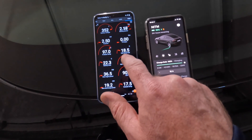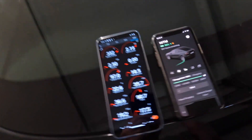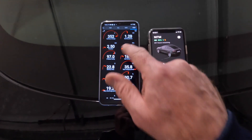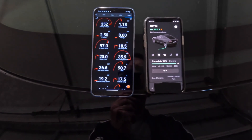The cell temp is starting to go up and you can hear that buzzing noise — that's the rear motor kicking in as a heater. The draw for this preconditioning — I'm only plugged into a 240 volt 10 amp point. The draw for all this is going to be more than what that power point can supply, so it is going to draw some from the battery.